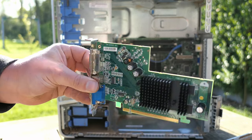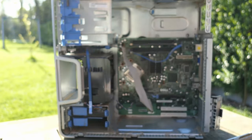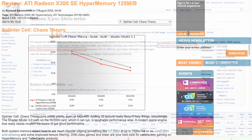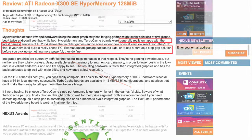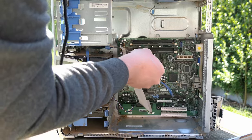That looks a lot better. The ATI Radeon X300, in this case equipped with 128 MB of memory, was a popular option for this kind of OEM PC, especially with Dell apparently. It was a real budget card and can be best compared to Nvidia's GeForce 6200. Don't expect top performance here, especially if you expected to play recent games at the time of release. Nevertheless, together with the Pentium 4, it's not too bad for retro gaming.